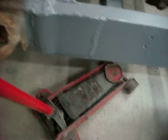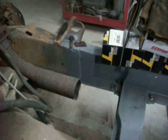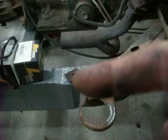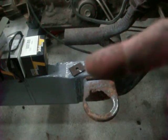The frame is completely finished as far as welding goes. I welded that and that's a plate you're looking at there that goes over top and is welded to the existing frame. You can see the other one on that side — I have a plate there on the inside and out. My new frame actually slips inside this old frame about four and a half inches. I welded that up and then I put this plate across here, and on the back side I also put another plate there to tie it all together.